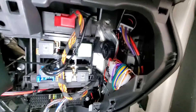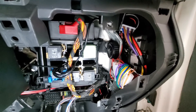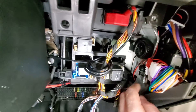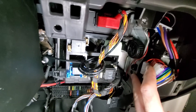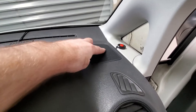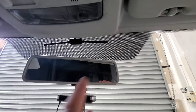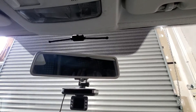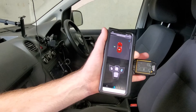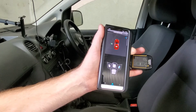The installation is now basically finished. We've got the interface mounted back up here — it's a lot smaller in size now because I took the remote start module off the side. We've got the shock sensor mounted up here and the learning reset switch mounted just here — that's only used if you want to code new remotes to the system or the system malfunctions. We've got the deterrent LED mounted up here, which is also the Bluetooth module so you can use it with the app. And lastly the pager antenna, which is mounted up here in the middle of the windscreen. The name of the app by the way is called eSpy, and that can be downloaded from the Google Play Store or the App Store.